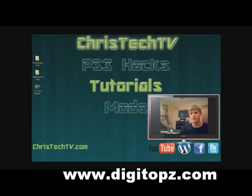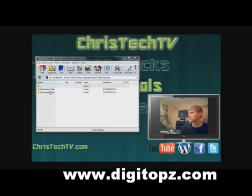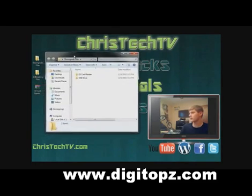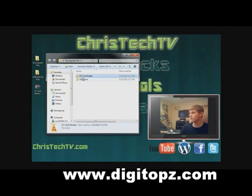Now at the computer, let's go ahead and get started. First I want to show you how to downgrade your PS3 using the E3 card reader. You're going to need a couple of things: your E3 card reader and a regular USB flash drive — make sure it has at least 200 megabytes of memory, so any flash drive these days will work. Download the file from the description below, bring it out to your desktop. You'll see it's a RAR file — E3 card reader. Open that up and extract the two folders to your desktop: downgrade files and jailbreaking files. Open up the downgrade files folder first. Inside that folder you'll see the E3 card reader folder and the USB drive folder. Right now we want to use the E3 card reader folder, so go ahead and open that up. Now insert your E3 card reader into the USB port on the computer.